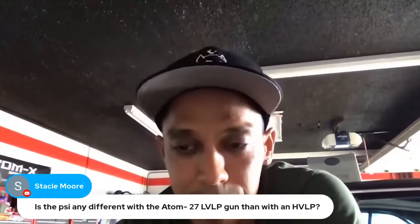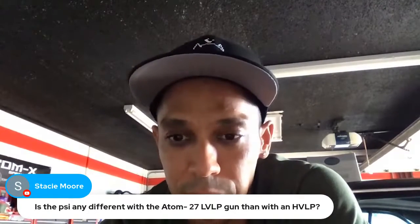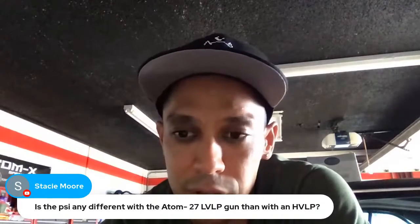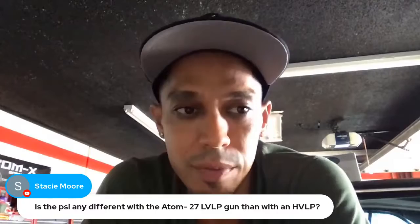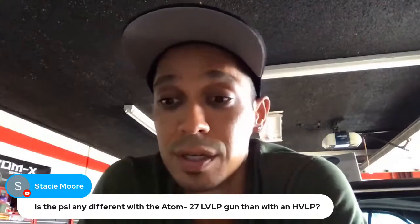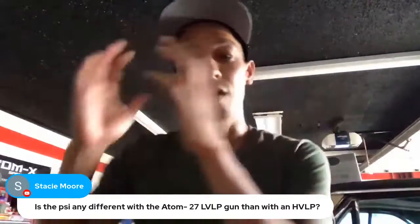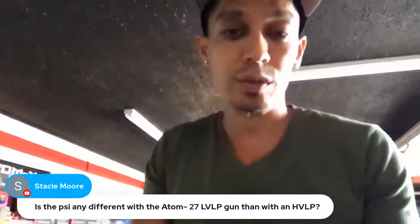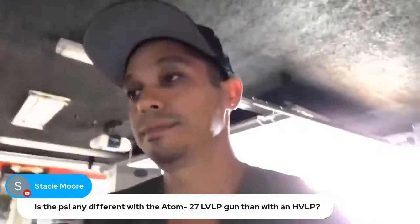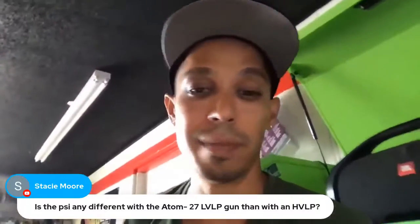I'm not sure what application you're doing. Are you doing clear coats or base coats? They say with base coats it's better to use a high volume, low pressure, and for clear coats, low volume, low pressure. But I've sprayed both base and clear and single stage out of high volume, low pressure guns and low volume, low pressure, and still got great results. I mean, you can't even tell the difference with the results. So it really doesn't matter. I don't feel like it really matters at all.